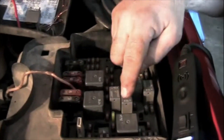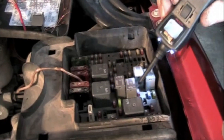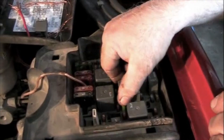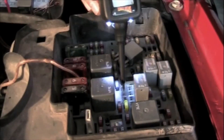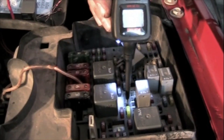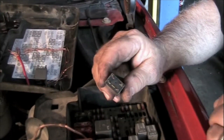Here's a quick way. If you look at the relay box, you can see that they're oftentimes buried. If you want to try and test it, you can't get underneath it to back probe it. You pull it out and many times you can't even get your test probe down in there because they're recessed. So how do we do that? Well, you take the very same relay you want to test and we're just going to make it its own tester.